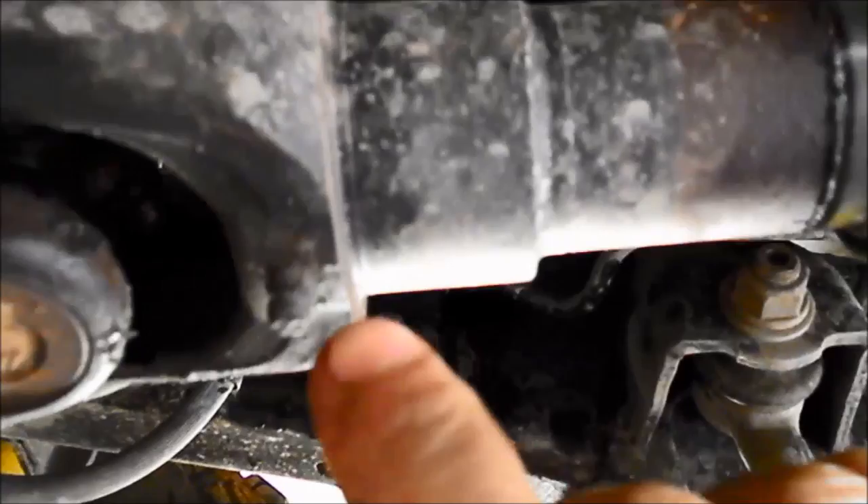You can see the grease nipple here that lubricates the splines where this moves up and down on, and there's another one on the universal joint — sometimes it's a bit hard to reach them. So I just place a screwdriver over a rag. It's important to give them a good clean externally before you pump the grease in, or you could be pumping road dirt into it — good for the mechanics but not good for the owner. On the rear tail shaft there's no splines so it hasn't got it. On the front tail shaft from the transfer case to the front diff they've got the same — you can see the grease nipple that lubricates the splines there.